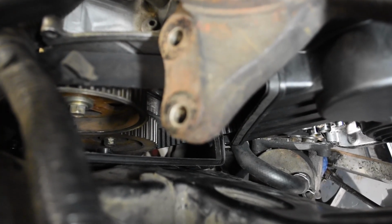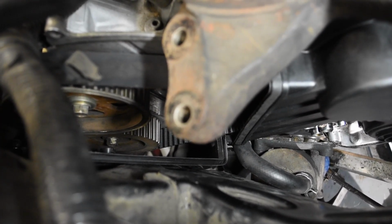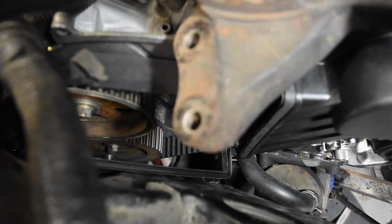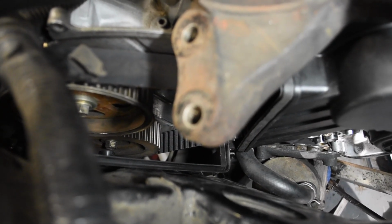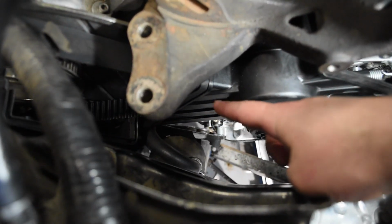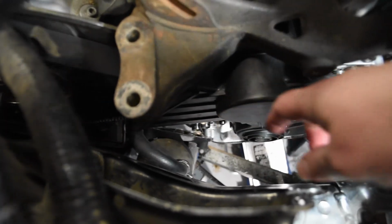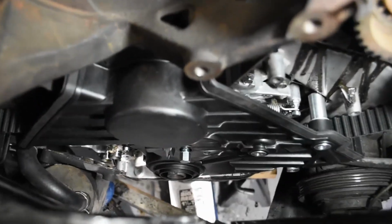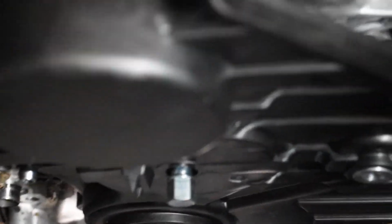One other note that I'll make, you can see over here, maybe, that is the bottom edge of the rear upper cover that I stuck in there before I put this down in there, because it's way easier to pre-position that for future manipulation before you put the lower cover on, because otherwise you end up with a little bit of a restriction between here and the frame. So the other thing I'm going to want to do now that I have the lower cover on